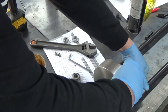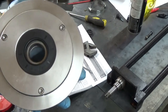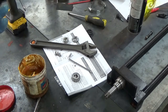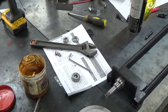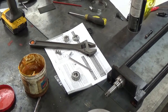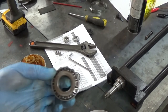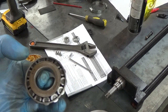Then we take the wheel off. The seal is extremely difficult to remove so re-greasing that one is even harder. Seal removed — that's entirely another subject, getting seals out without damaging them. This is the inner wheel bearing; it is bigger than the outer wheel bearing, which is normally the case with tapered roller bearings.